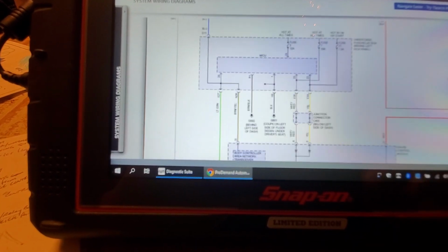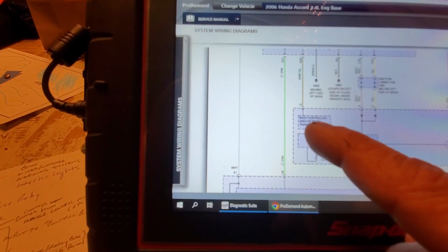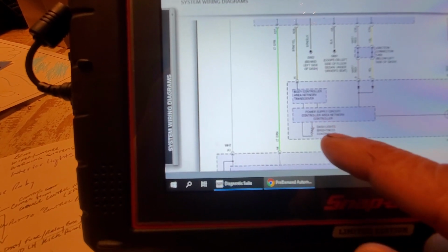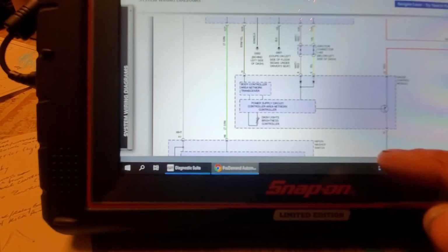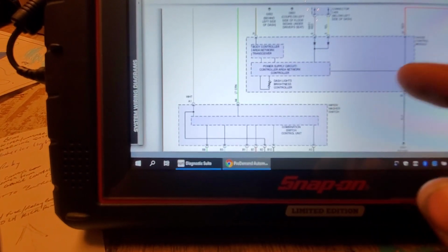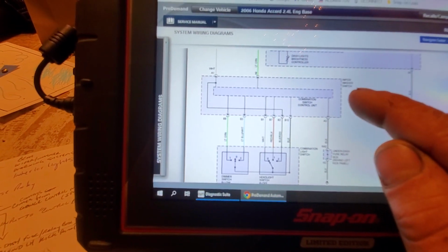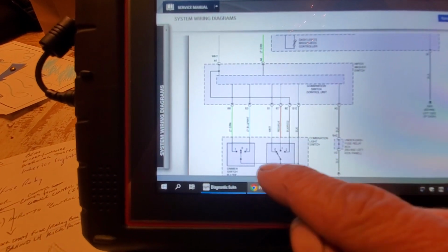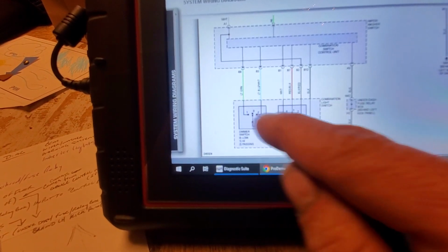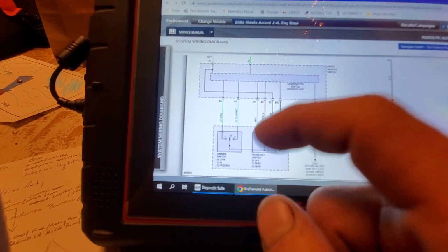Yeah, right here. Is this it? Except hybrid. Instrument illumination circuit. Look what it says here. Body controller area network transceiver. Power supply circuit, controller area network controller. Gauge control module, dotted line, right? So why they're showing that, I don't know where this thing lives. This gauge control module, I believe I seen it, and then there you go, wiper washer switch. So there's more going to that wiper washer switch. You got your interior lighting, your headlight switch, combination light switch is going to that wiper washer switch, and that combination switch control unit within it does quite a bit.